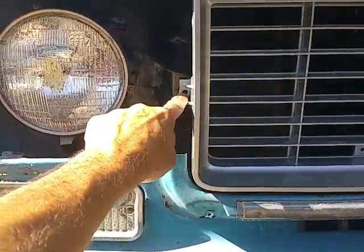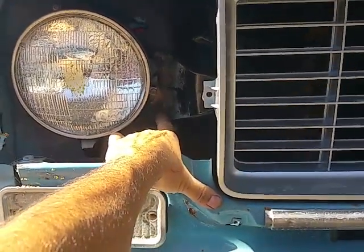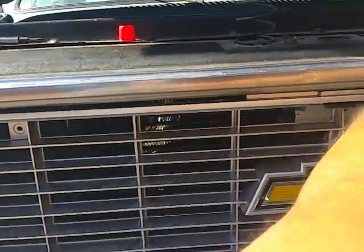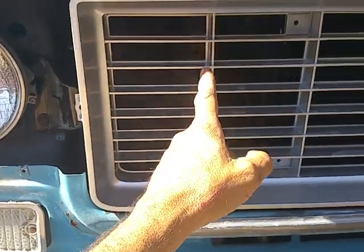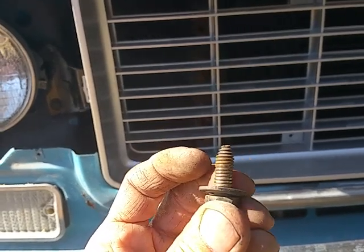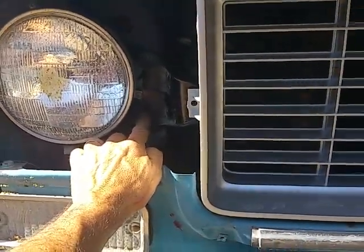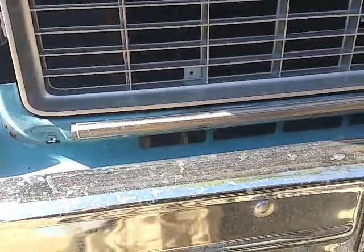What I did was, when I got the grille, I mounted it to the brackets, kind of wiggled it in here, and made sure the dimples matched up. Then you drill a fairly small hole — and I say fairly small because GM, when you take out these side brackets, you'll be left with some bolts like this. These bolts are pretty impressive because if you get them started in the smallest little hole, they will thread themselves in and you have a factory-looking job.